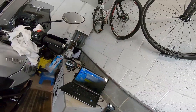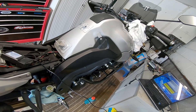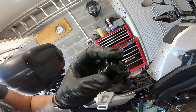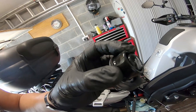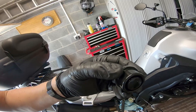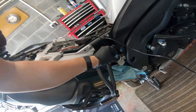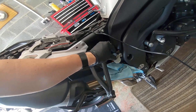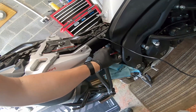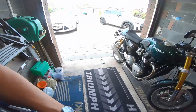That's done, so now we can top that up, tighten everything up, and that's the rear brakes done. When you push this back in you've got to make sure that it's not creased or anything, because it's the shape of this that helps release the pads off the discs when you let go of the pedal. Just push that gently in place, give it a wiggle and put its lid back on.